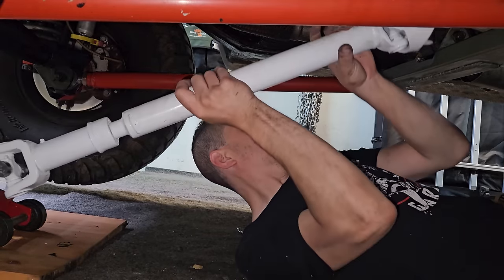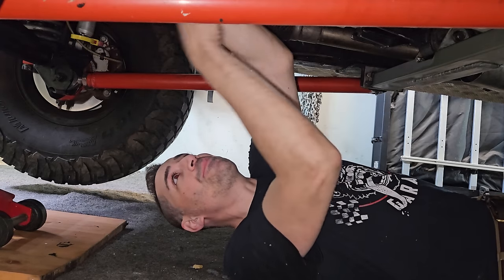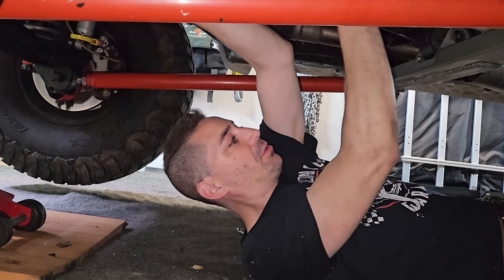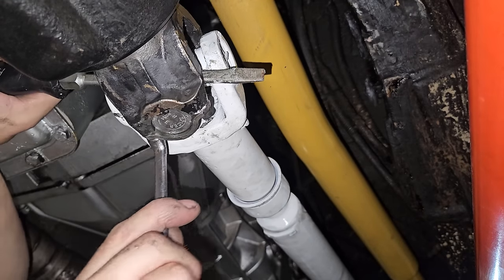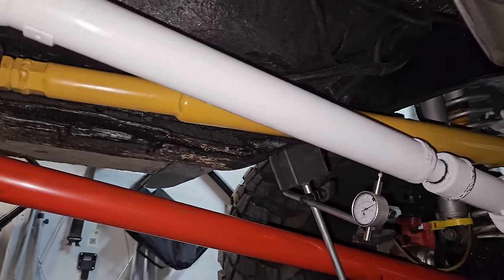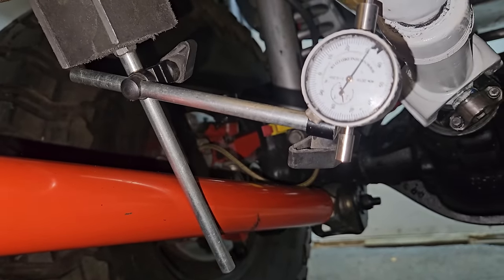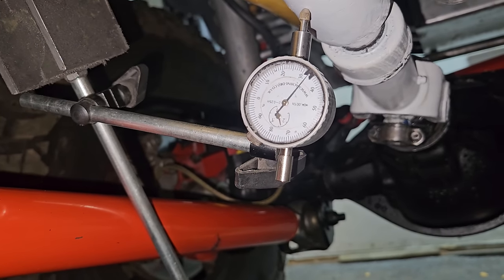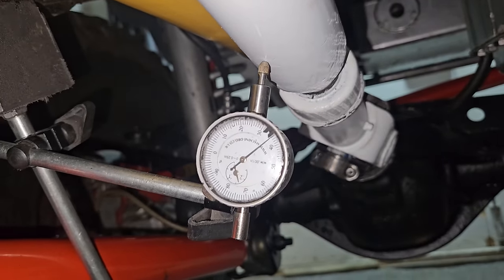Just an observation - yes, I did paint the mating surfaces and the U-joint caps. I have scraped that away, as you should do, or just maybe mask them off - unlike what I did. There we go, all buttoned up. The shaft is all installed and it's looking pretty good under here. Just giving it one last check - it really should be as close to the end as possible. It's too dirty, but I think it is around about ten thousandths. There are a few manky paint spots, but we'll see how that plays out.